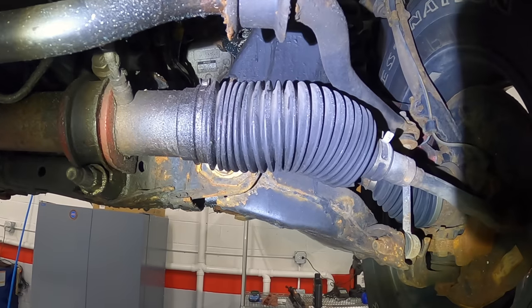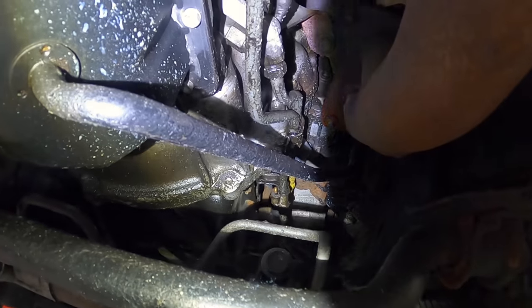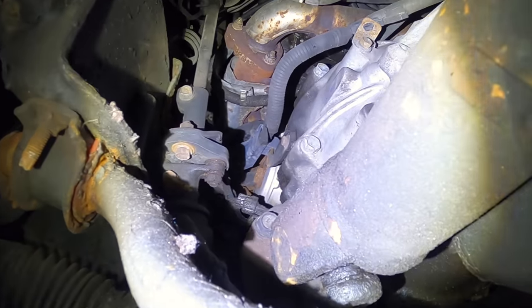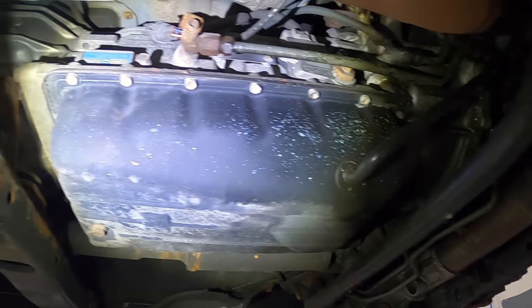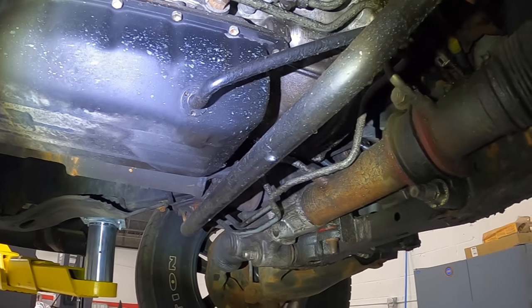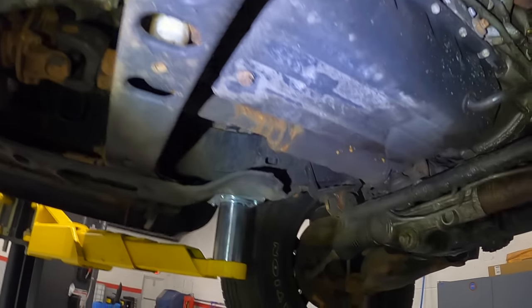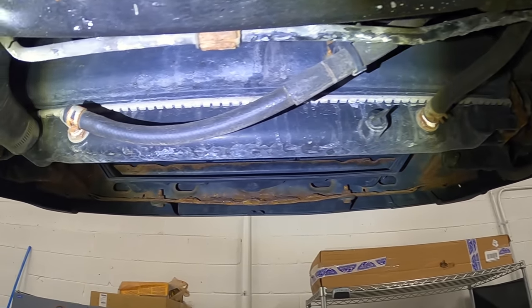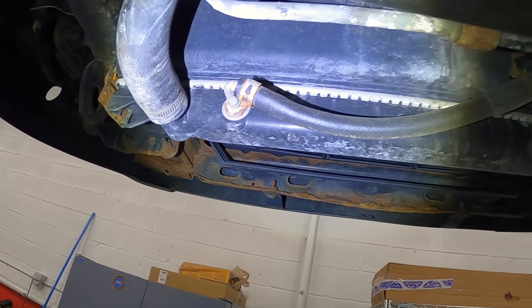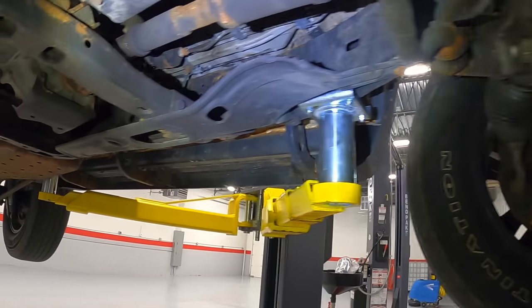Something else notorious on these is the rack and pinion — it leaks over time. Now all this oil you see in this car is coming from the top, from the valve cover. The valve cover has been replaced but somebody didn't clean the residuals. Moving on, we're going to look at the transmission. The most you'll get with these is a leaking transmission pan — this one is not leaking, so it's good. It's a very solid transmission with the exception of one problem: these are notorious for the transmission cooler inside the radiator to mix coolant and transmission fluid. This is not a good thing. If you have one of these trucks and the radiator is original, replace it — they are notorious for mixing and we have problems.